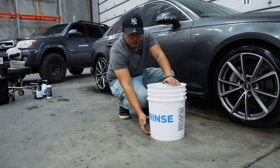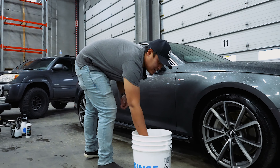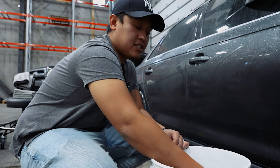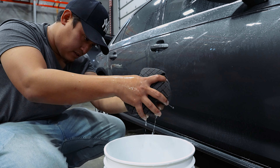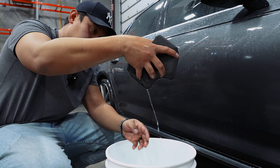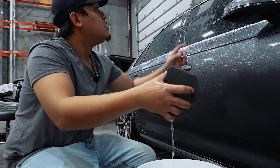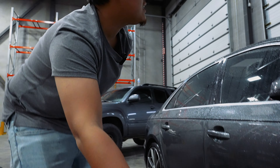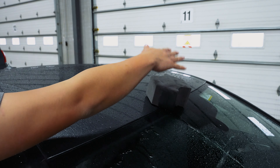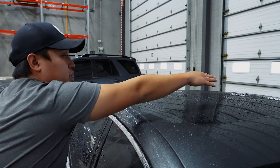Let's get down to actually doing a contact wash — let's start on the roof. Before we get into the contact wash, make sure your sponge is just barely dripping — we're not gonna super overload the sponge with solution. So with this panel, I'm gonna go one side, and as I make my way down I'm gonna switch to a cleaner side. We're not gonna put a lot of pressure into the sponge, we're just actually gonna help it glide. And we're gonna go in straight motions, not in circular motions because...